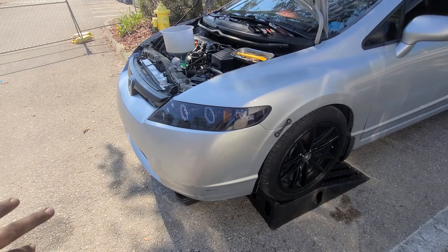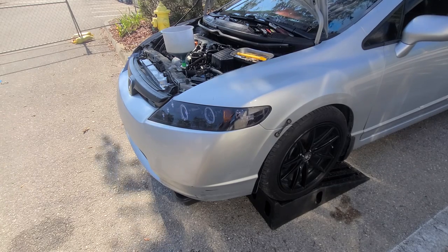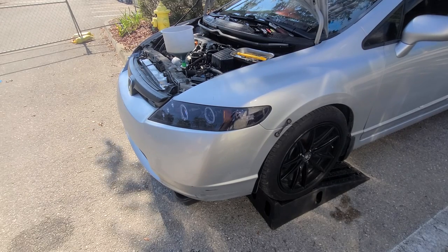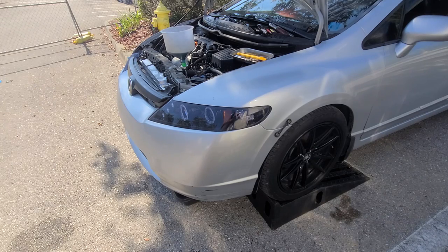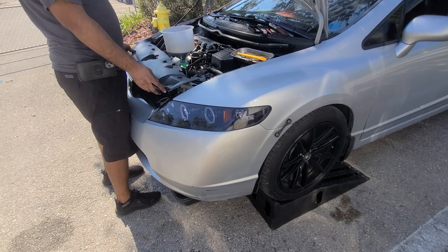He's gonna put some zip ties on the bottom because he doesn't have anything else to hold it. But that's it. Alright guys, so now it's just a matter of getting the air bubbles out. Then let it run for a minute, open up the thermostat, circulate, good to go. I just gotta put the top cover back on with a little plastic clip.